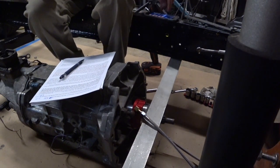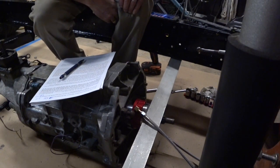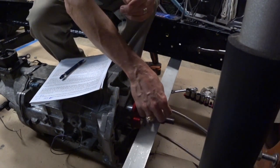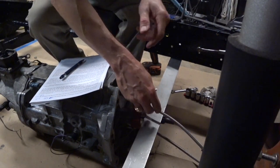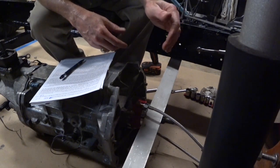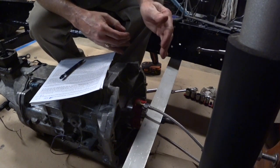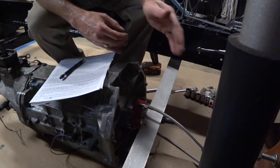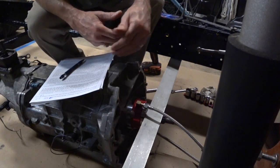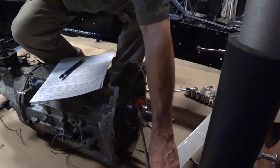So we're on the high side. We want it to be between 100 and 150. If I turn this thing one full loop out, so that it gets closer to the clutch face, the pressure plate face, that means we're going to gain 60 thousandths. I could do 30 thousandths, which would be to turn it half. So let's do that, and then we're going to remeasure this little guy.